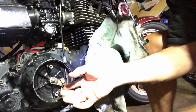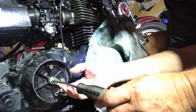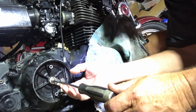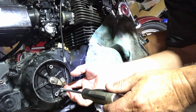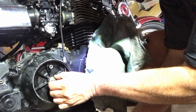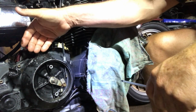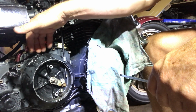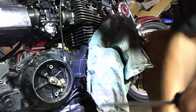So from there, we need to move this between 1/4 and 1/3 out, which is not very far. And that will give you the movement, because you can actually see the tiniest little bit of movement, so that you know the clutch pack is shut, all your springs are hard, holding everything tight, and that there's no actual weight on your mechanism.